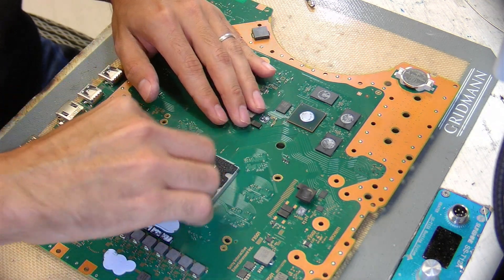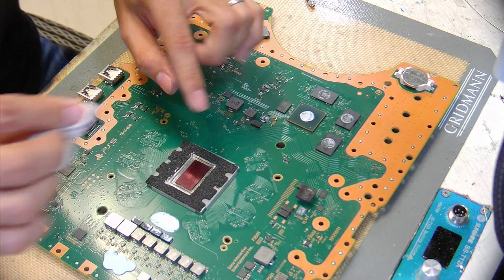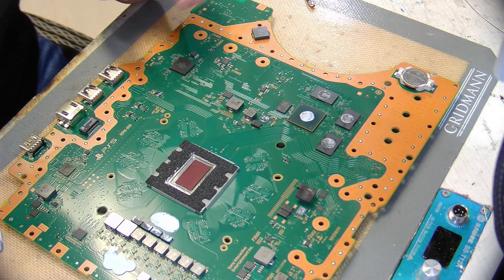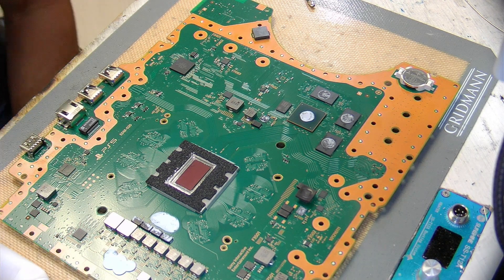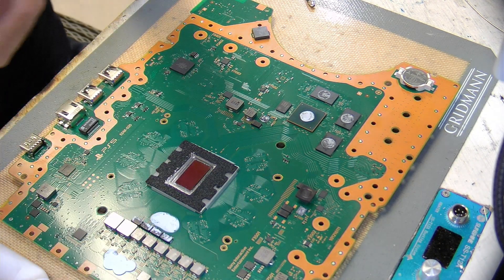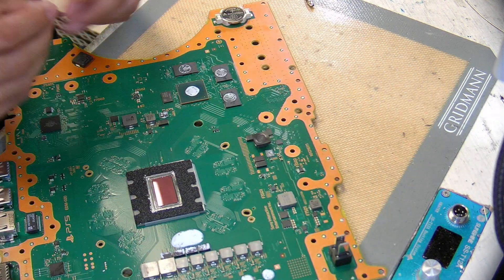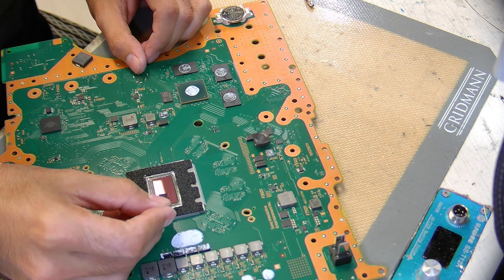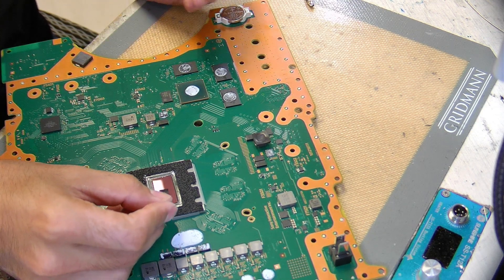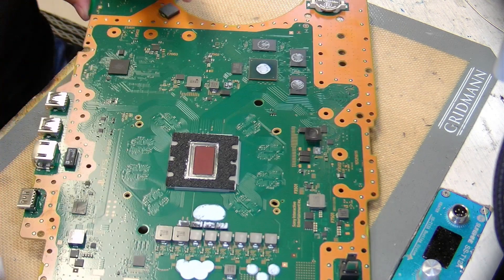Normally it's not too big of a deal, but if it's too thick of a residue, it'll still overheat. In which case, take a flat blade like this and, going over the top at a very, very shallow angle, just scratch it like this until that residue comes off. Then clean that off with this little wipe.